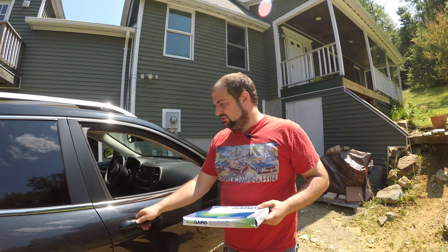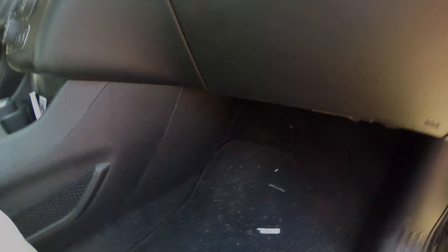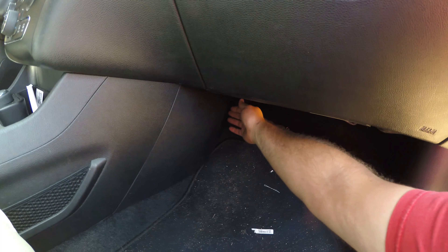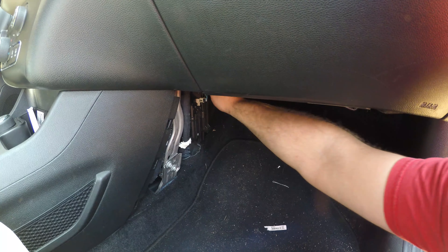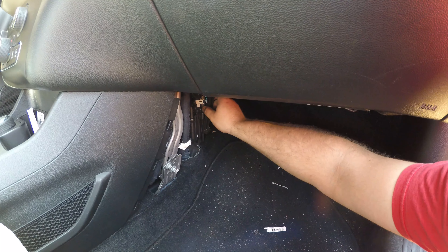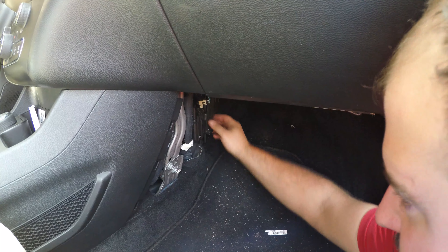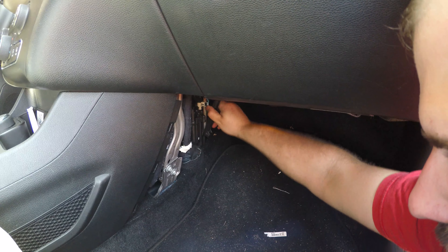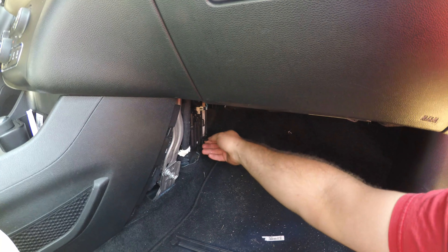In order to do that, we open up the passenger side door. The cabin air filter is behind this kick panel — grab it from right about there, pull it, and it'll slide out. Put your panel out of the way. Your filter is here. You'll have to press a tab — there's a tab at the top. Tilt it back, and there's a tab at the bottom as well. Push down on this tab to get it out.